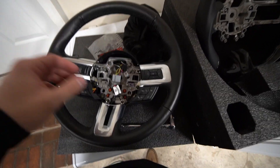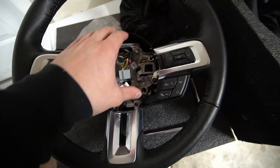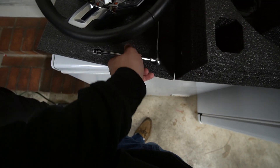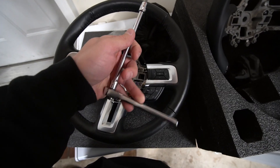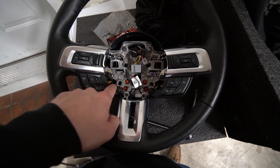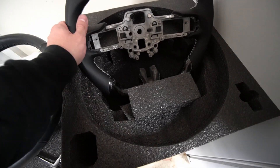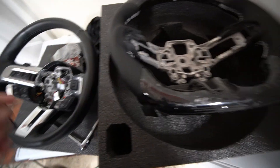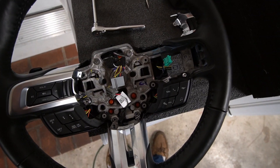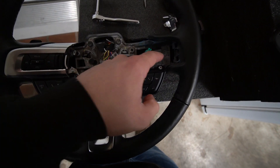Once you've got the steering wheel out it slides right out — it's kind of like a hexagon, you really can't mess that up, it goes in one way and comes out one way. Once you've got it out, there's a bunch of little screws with a star key — I don't even know the name of it — but I got a little extension just so I didn't scratch any plastic. These are kind of cheap and delicate, so have both steering wheels next to each other and do one piece at a time so it doesn't get too complicated. Make sure you go extremely slow and take your time.